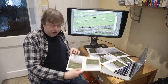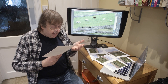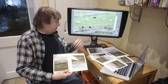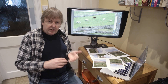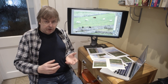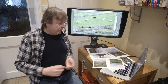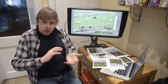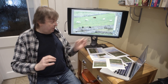When I looked at Standard versus High setting, I can see quite a difference — I can almost see it with just my reading glasses. The standard resolution looks slightly more grainy, and there are two reasons for that. One I found when doing initial test prints: the printer needed its head aligning again. On printers like the Canon Pro 300 and 200, you align the heads when you set them up. However, over the course of a few months — particularly with a new printer — things may bed in slightly, there may be slight movements, and it takes the tiniest movement to throw things out.